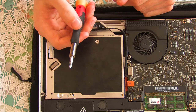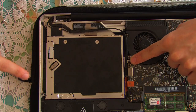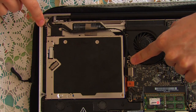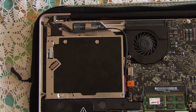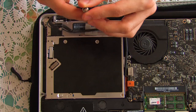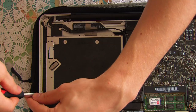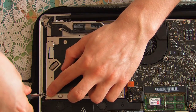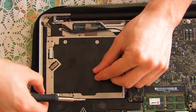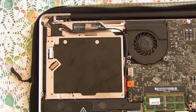You can use the same screwdriver that you used to open up your laptop to undo three screws which sit here, here, and here. Before that I'm going to use a Torx 6 — a six-sided star screwdriver head — and take out one of the adjoining supports for the back cover. That's a tiny piece so look after those two. Next I'm going to use the Phillips screwdriver to take out the three screws.